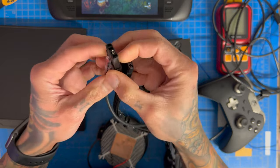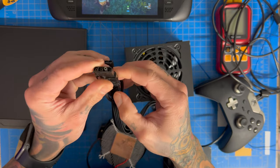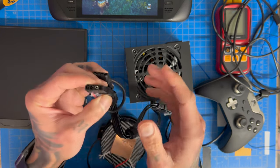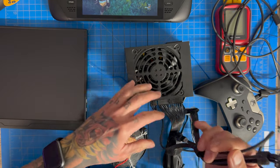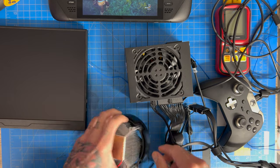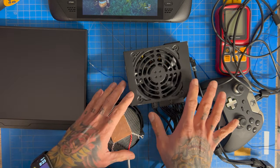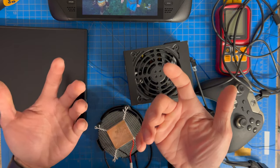On a Molex connector, the two center pins are ground, the far left is 5V, and the far right is 12V. I'm not 100% sure on the amperage but it should deliver whatever the device needs — whether that's 9 amps or 3 amps. The peltier and the Wraith cooler fan are both connected to the power supply; the fan runs on 5V. Together, these two components draw just over 90 watts.